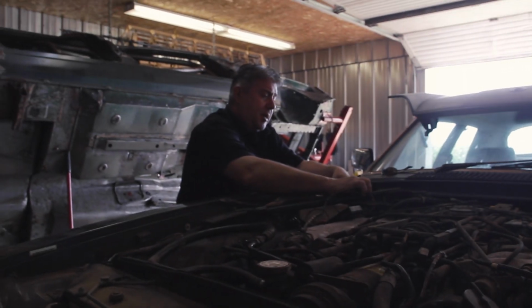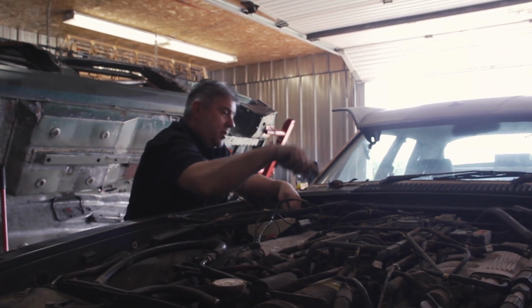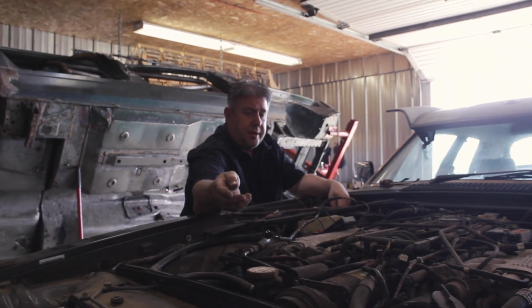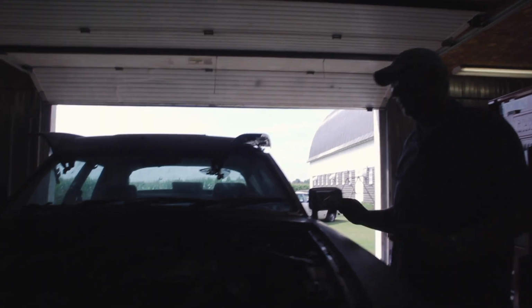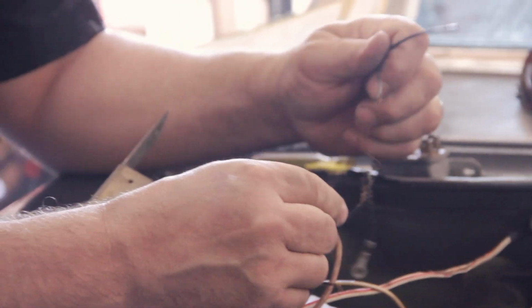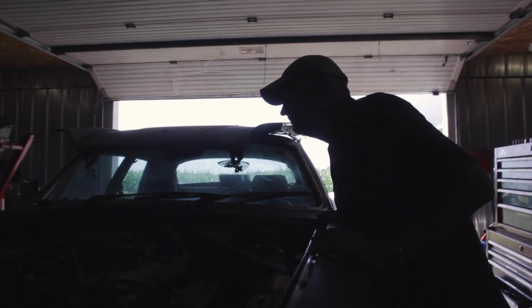So I pulled this plug out and I checked it here and it was fine. But then after I pulled this out, because it loops down through here and then over to this side, once I pulled it out, it had continuity. Okay, so that's cruise control. The insulation is compromised. There's a cut on it, so it's possible that the wires are chewed up a little bit. So we can just pull that off and put that on the bench. When we get it running and we need to get the cruise control working, then we repair that.